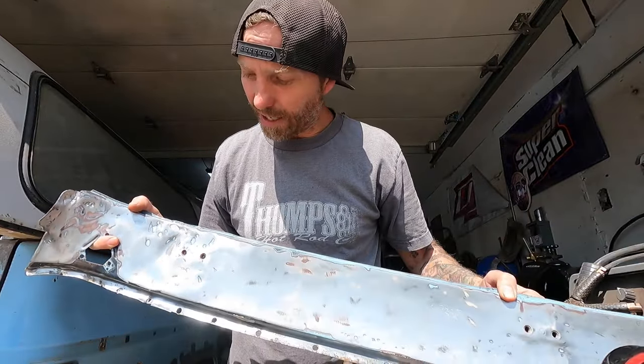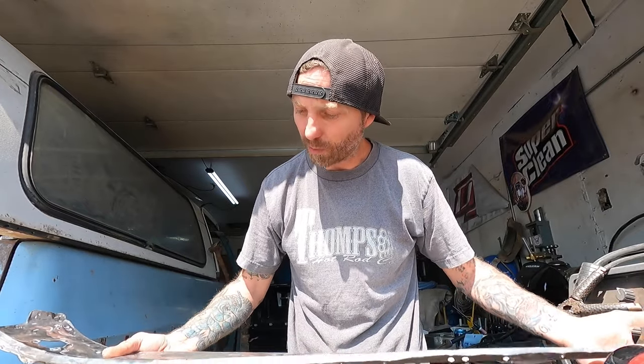The first thing is: when these panels are made, it is spring steel. They stamp it with a tremendous amount of force and that steel basically kind of turns into like a spring steel. It's mild or whatever they use, but when they stamp it, it gets shocked and smashed into that position. When you get damage on a panel like this where it's all pushed in, this panel doesn't want to be like this — it wants to be the stamp that came out of the machine. That was like a million tons — or whatever they put on this. Maybe ten tons or however much force they stamp this out of a flat sheet, right, in one whack.